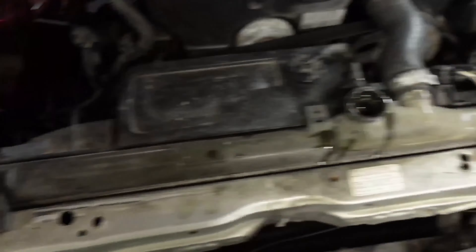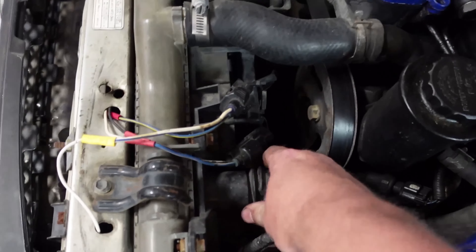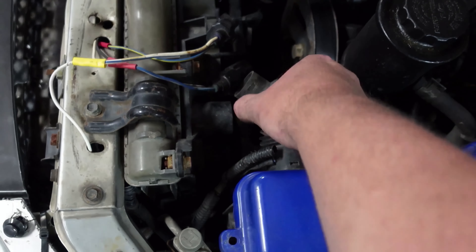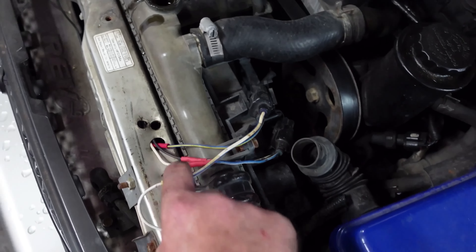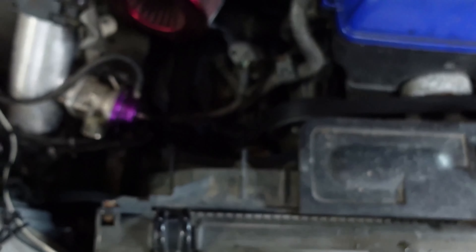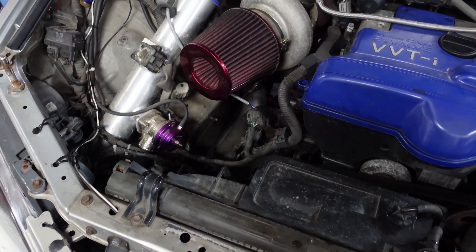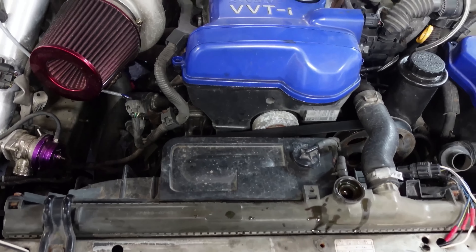Once you get to the top, you've got these two bolts up here, a couple of fan plug-ins, and this tube that comes off the fan and blows cool air into your computer. If that thing spits water it goes right into your computer, but I guess that's the design. They've got some janky wiring on it — straight wire to fan switches — so this one won't have an actual temperature sensor. At the bottom on this side there'll be one plug that's your fan temperature switch. If your fan isn't kicking on, that switch may be bad — easy to replace while you're doing this job.